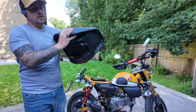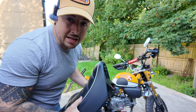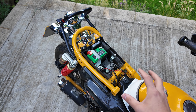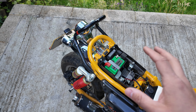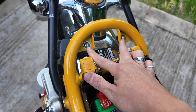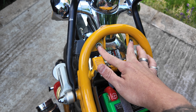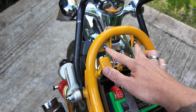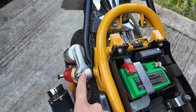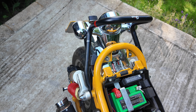And that's your seat right there. As you can see, it's basically just these two threads right there - hammer it and it lifts straight off. And then you're left with this. This is where your battery is kept and everything like that - we're not going to touch anything like that today. We're just going to take these two nuts and bolts out right there. This is a bit different on the G-Craft, so I don't think the screws are going to work with the new one. But we're going to take them two out, loosen the shocks up, and slide this out and put the new one on.